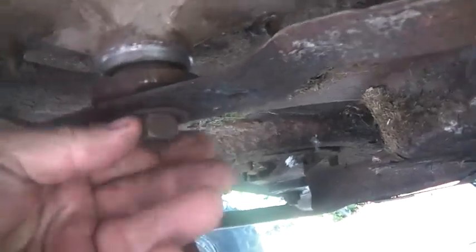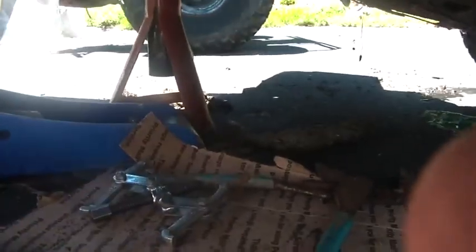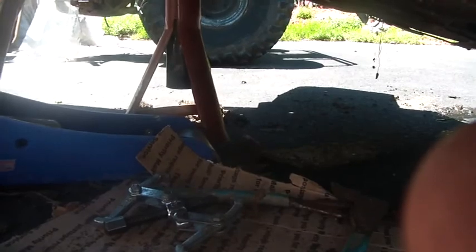So obviously I loosened the bolt up, and dropped the bolt, the washer, the blade, and you can see in this case there's another few parts that go in here. There's a pipe in there, and then the bearing, there's a pipe that keeps the bearing from pushing in too far, and then this piece goes up here like this, and it's got a splined area here.